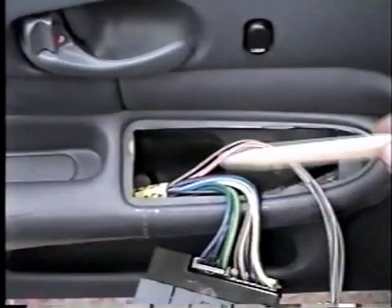Another window-related noise on the rear doors of very early production cars was a rattle or rumble that was heard when the door was closed. When you close the rear door, you had a rattle condition. And this was caused by the electric motor hitting the inside of the door pad itself, and this is like a rumble when you shut the door.